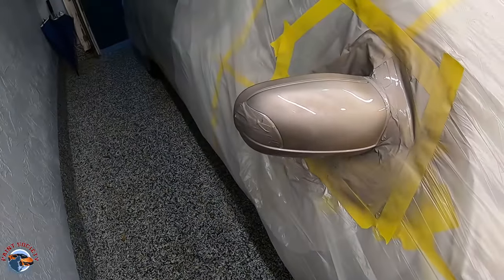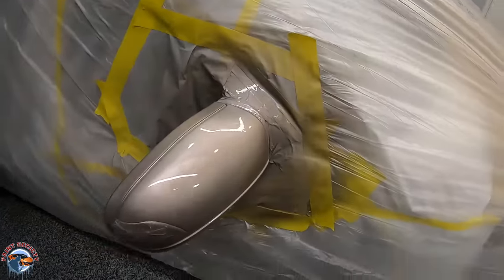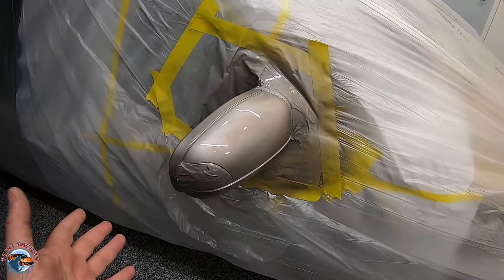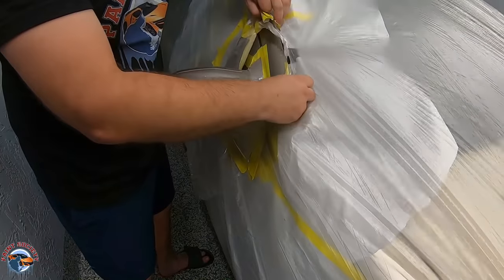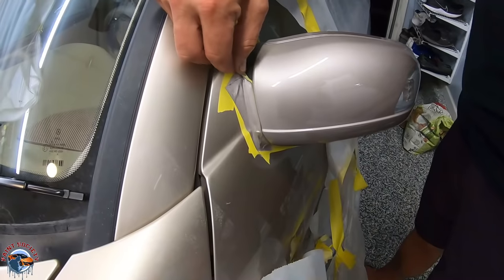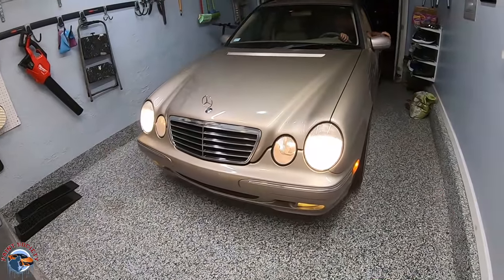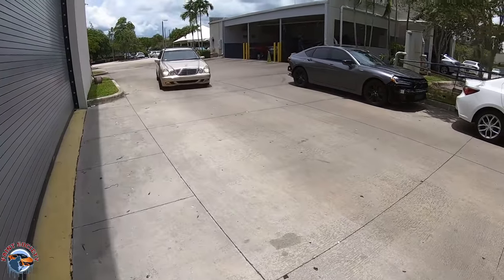It's been about 10 minutes since we sprayed and there's a slight haze still in this area. We're painting at night so it's not going to dry as quick — give it a little bit of time. Two coats is all we need. It's got a beautiful gloss to it. The color match isn't perfect — it's a little bit lighter — but it looks a hundred times better than what it was. After a good hour and a half they were nice and dry, all haziness came out of the clear coat. We took off the tape carefully so none of those edges bridge with the paint and peel it off. Daylight shots revealed they matched pretty well.